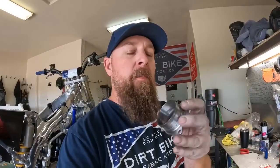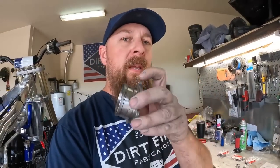Radiators and hoses are all installed. Now it's on to the expansion chamber pipe exhaust system. One little tip, if you guys are CR500 guys: in order to make this manifold seal to the exhaust pipe, there's one trick you can do. A lot of people put silicone on there, but I wouldn't recommend that because it doesn't let the pipe move from the vibrations of the motor.